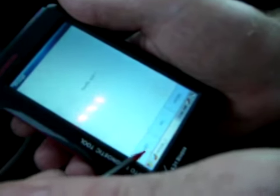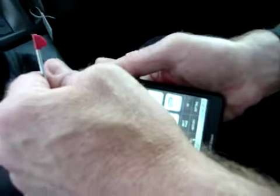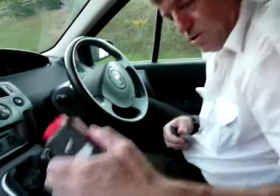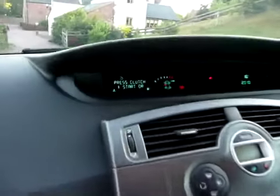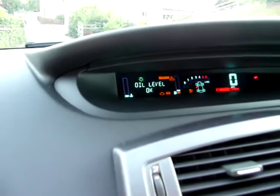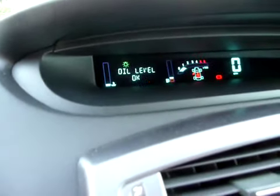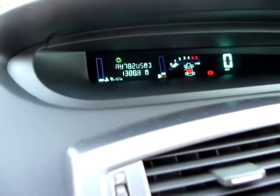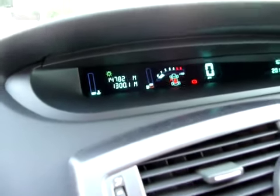Return, return, return, quit — back to the main page. I can now switch this off. I'll switch the ignition off and pull the little transmitter out. If you look at the dash now, I'll restart the engine — and hopefully the fault code has gone. The service light was on before; now it's off. That's it, it's all gone. Thanks very much for watching.